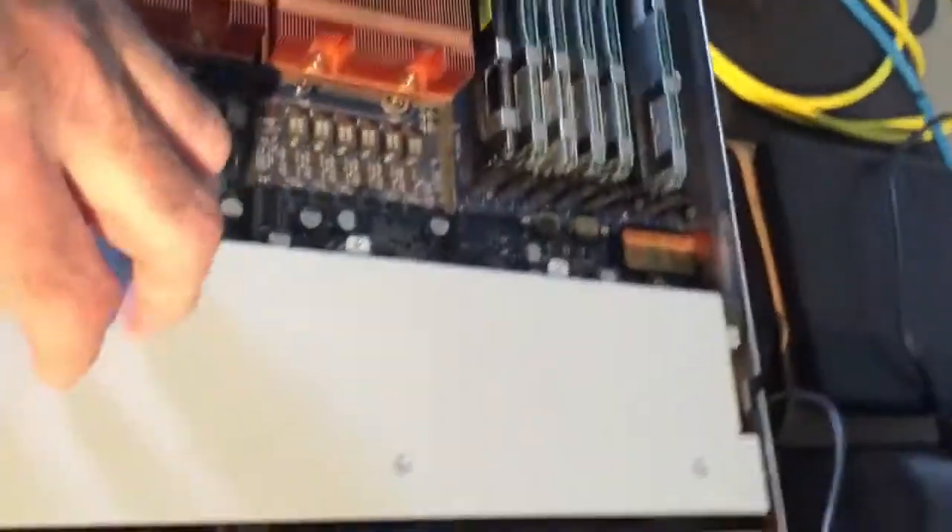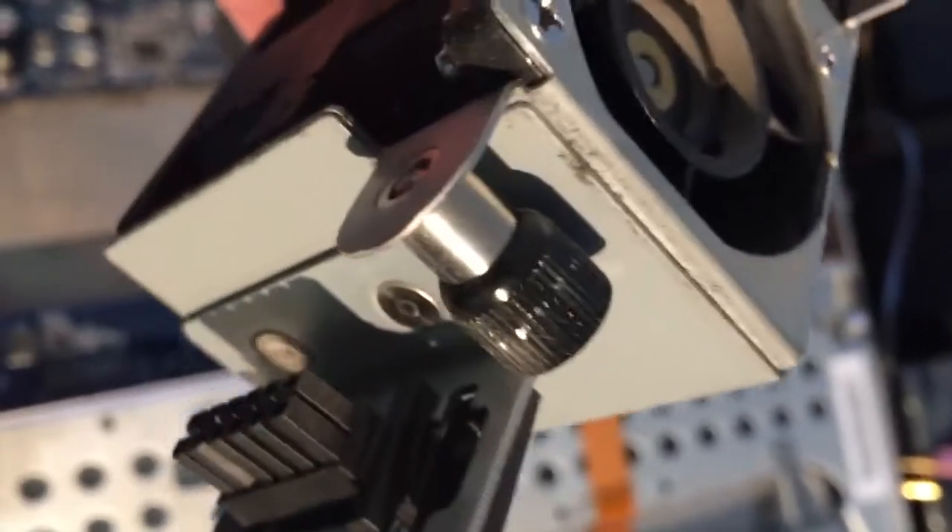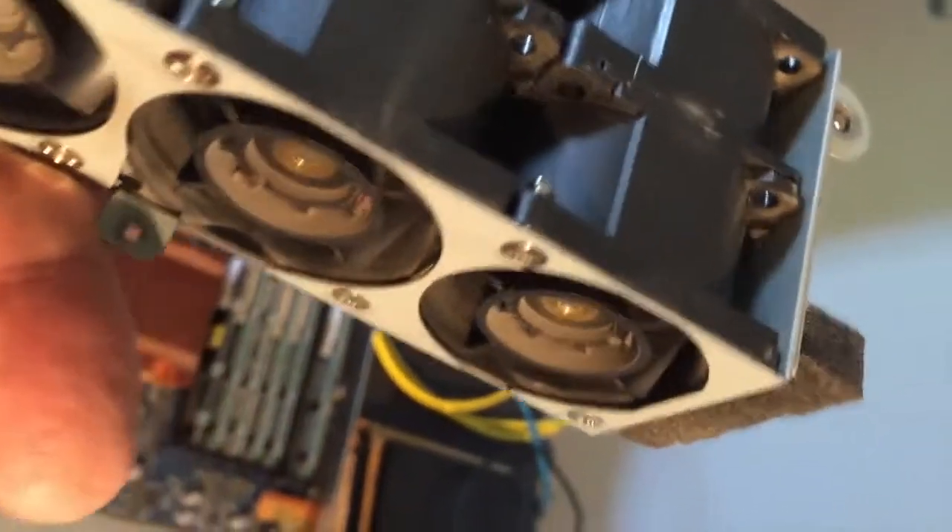This fan module has to come out. There are actually two screws on this fan assembly — one way in the corner and one on the right side. You loosen them up; they're kind of spring-loaded, they stay together. This is really well engineered. Then this thing just pops out — the connector pops right out of that hole. Nothing to disassemble, just unscrew it, wiggle it, and pick it up. Now I can get in there and dust it with compressed air.